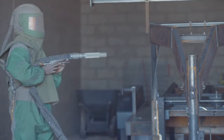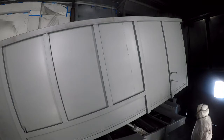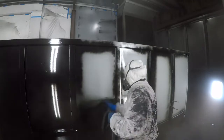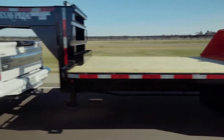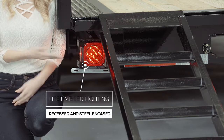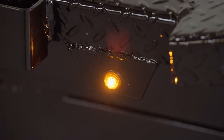The paint and finish on this trailer are nothing less than top notch. The process starts with a full media blasting to remove any surface rust or scale. Then each trailer is fully primed top to bottom in preparation for the two top coats of automotive grade acrylic enamel paint, all of which is done in our new state of the art paint facility. This ensures you have a protective, durable and shiny finish for years to come. Lifetime LED lighting is standard for all Texas Pride models, and all lighting is either recessed or steel encased to protect them from accidents and the elements.